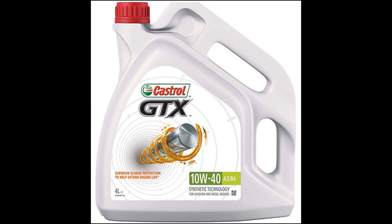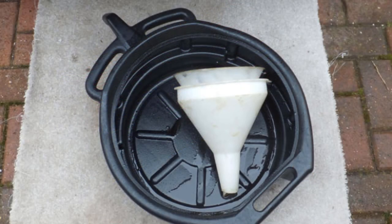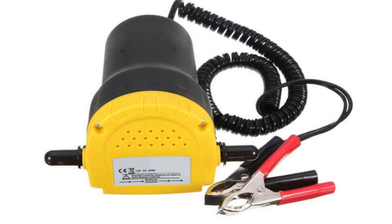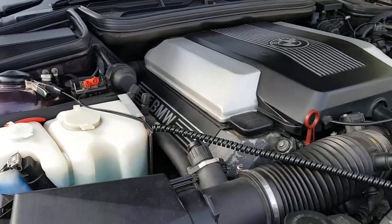I'm using 10W40 GTX, which works really well — no lifter noise — and the 26702 filter. You'll need the o-ring, the washer, oil catcher funnels. Today I'm going to try a fluid transfer pump; they're 12 quid from eBay. I have no idea if it's going to work or get much oil out, but in the interests of science I'm going to give it a go.